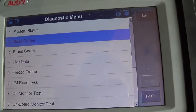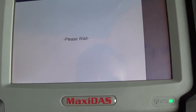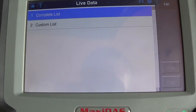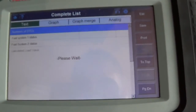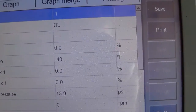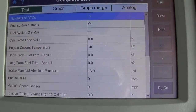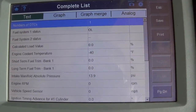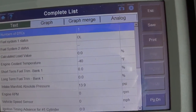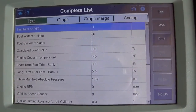Let's start with a quick visual inspection of the coolant temperature sensor while we look at our data to see if it's a hard fault happening right now. We immediately see our engine coolant temperature is at minus 40 degrees Fahrenheit. That means there's an open circuit in the signal wire of the ECT — if you cut the wires off, that's what you're going to get. The circuit has infinite resistance, and it's a thermistor, so the higher the resistance, the lower the temperature.